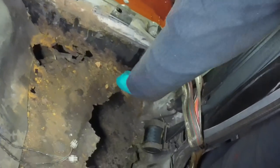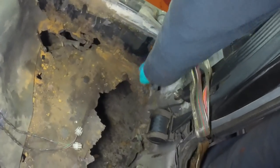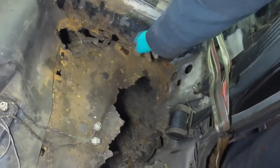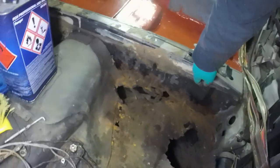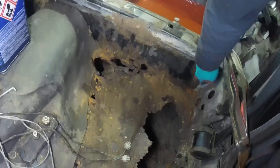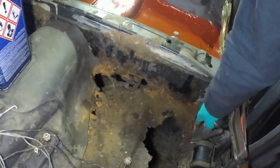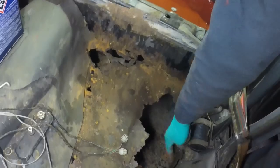My cunning plan, as far as it goes at the moment, is chop the heel board out first. Before I do, I'll take some reference measurements of the height of the floor relative to that line there. I'll mark it on here with a pen or maybe a notepad, and then I'll chop all of that out in a sensible place. Then I'll go and chop up the heel boards from the donor panel, and I can start playing how that's all going to go back together.